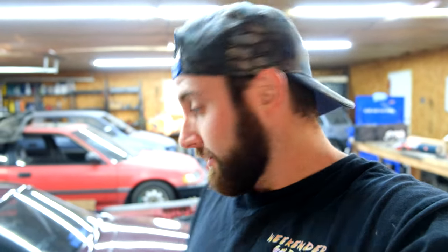If you watched the last video, you just saw that I was having issues with this gas tank pressurizing once it got below half a tank, and my car would be shutting off mid-drift, which is not good. So I got a couple of things I need to check. There's a purge valve I'm pretty sure that gets clogged, and then some other ideas that Cameron and Cody came up with is the exhaust is maybe too close to the gas tank and heating it up.